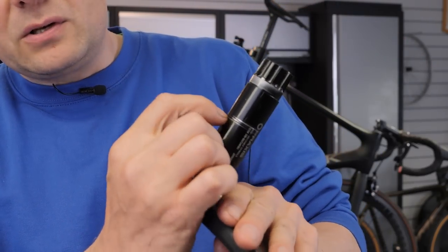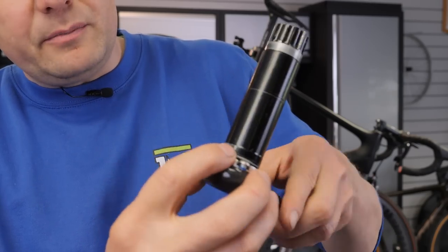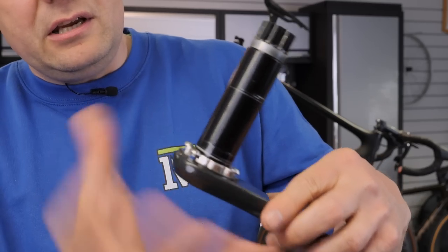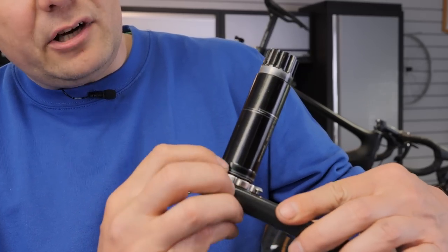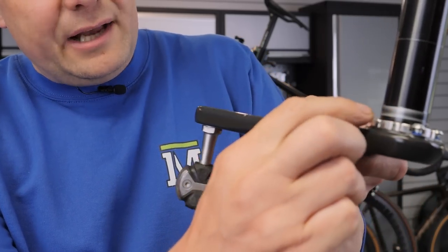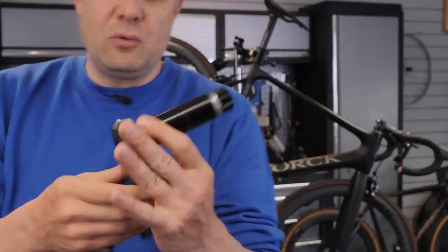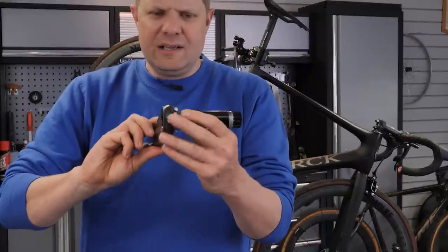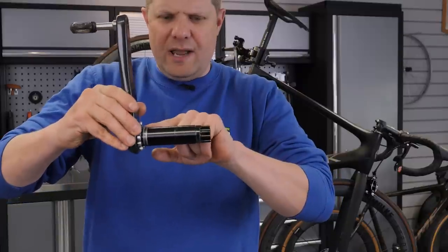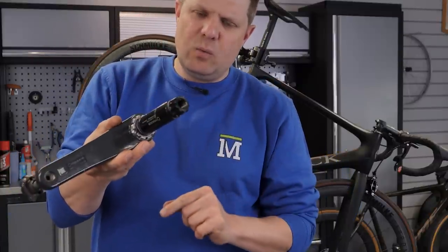This scar in the middle is caused by something on the inside which we need to remove, but we're mostly concerned where the bearings have been running. On the drive side, I've just removed the chain ring so you can see — black anodising untouched, absolutely perfect, and as we come round you can see that anodising has been worn away. You can imagine this act of pedalling with the bearing scarring away at the shaft, and then as we come round the pedal stroke the non-drive side is starting to be worn away here.